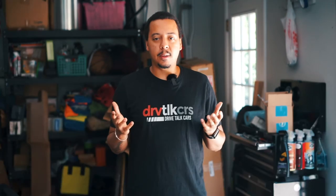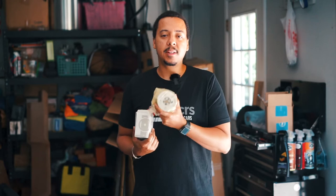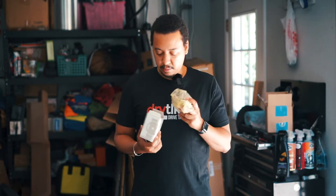I have to replace the camshaft adjuster because the pin trick did not work. The plate was worn out, so even switching the pin — flipping it — would not make a difference because the pin wouldn't stay in the hole due to the worn-out plate. I have a brand new intake cam adjuster from Mercedes-Benz.